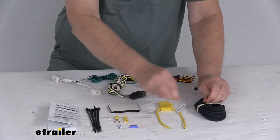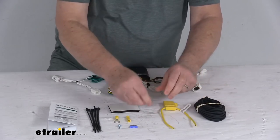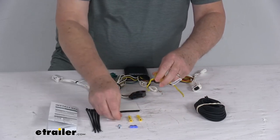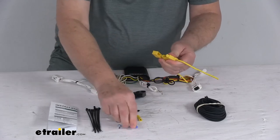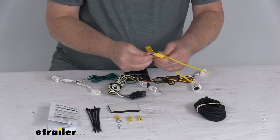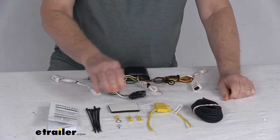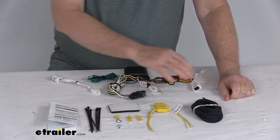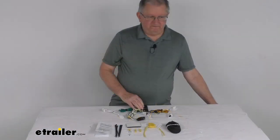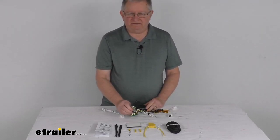You don't want to run the power wire directly to the battery — you want to run it through the inline fuse holder. Take another butt connector and connect it to one side of the fuse holder, then on the other side attach the eyelet connector and connect it to the battery. Pop open the fuse holder, take the included 15-amp fuse, install it into the fuse holder, put the cap on, and your system is all ready to go. They also include extra cable ties to take up any slack in the wiring. That should do it for the review on this Curt T-connector vehicle wiring harness with the four-way flat trailer connector.